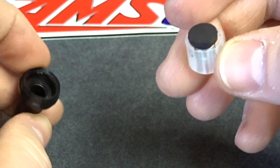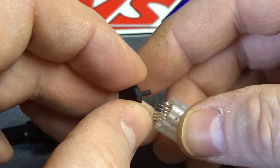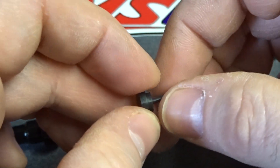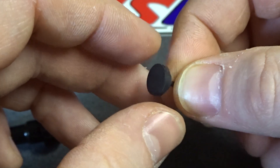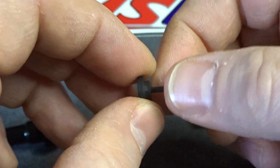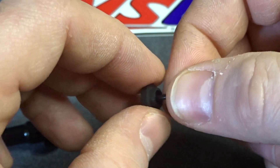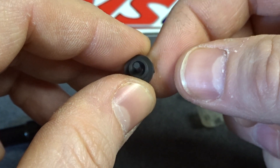This is a Viton-based plunger. The Viton material is typically rated for somewhere around negative 30 to negative 35 Fahrenheit all the way up to about 400 Fahrenheit. It's very temperature stable and it works really well. I generally rate these for about 250 Fahrenheit because I don't think you're going to see anything higher than that in an automotive application, but they are very good.